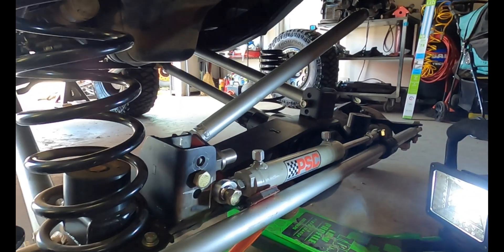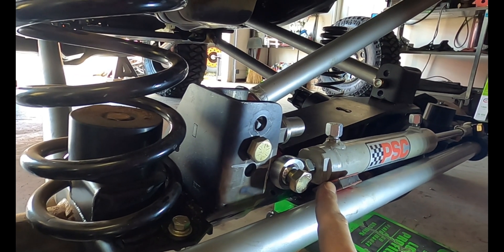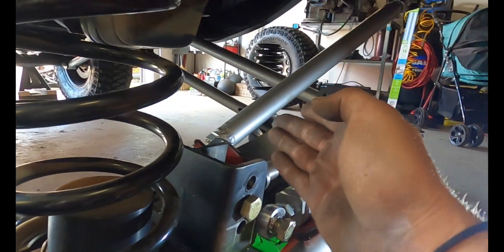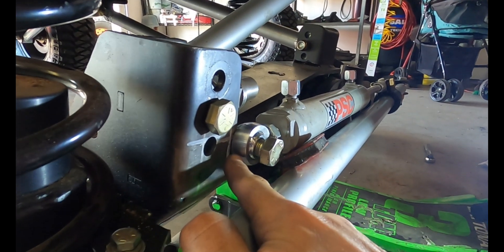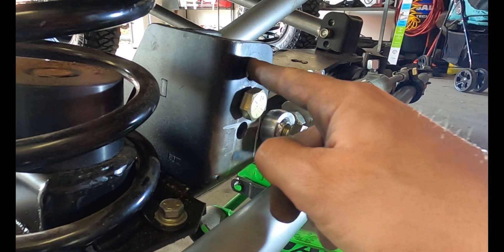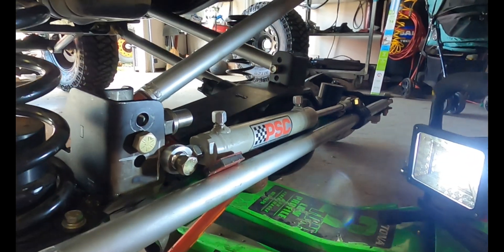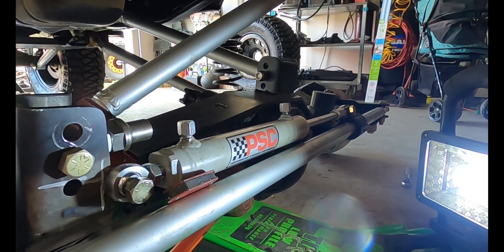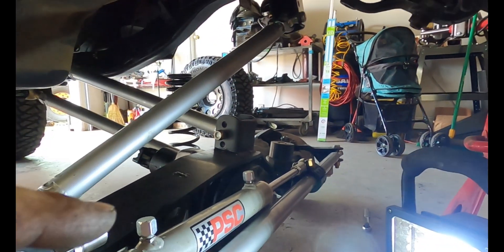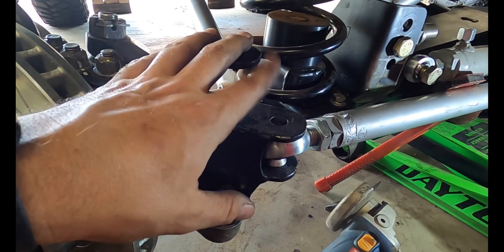What's going on everybody. Working on a few tweaks here — where we had the hydraulic ram assist before in front of the track bar, it was kind of underneath the actual track bar itself. So what we're going to do is move it in front of the track bar. We'll make a special double shear bracket that goes over top the lower mount. We'll still have adjustability for the upper two, and it should be super level — no binding in the heim joint, won't hit the diff or the track bar, and won't interfere with the pitman arm.